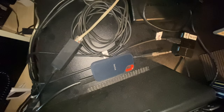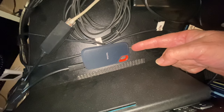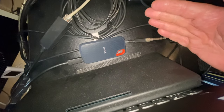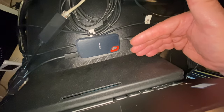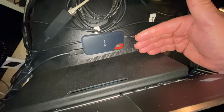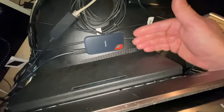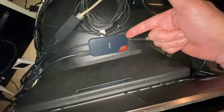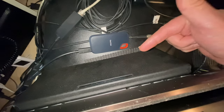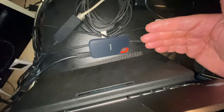The way I back up stuff, right, is such that if the operating system dies, everything is here anyway. I try not to use, for example, on Windows machines, the My Documents structure, because that structure is on the C drive. It's on the same drive as the operating system. Any documents, pictures, music, or projects that I create go directly onto an external drive. I do not use the My Document structure on the C drive because that is just nuts.